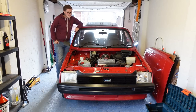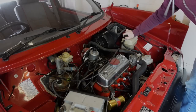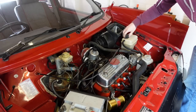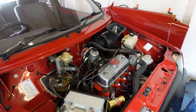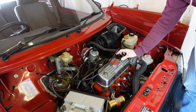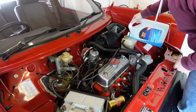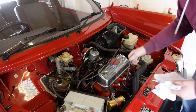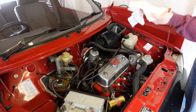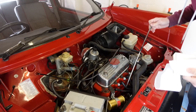With a few pumps of the clutch pedal any noises go away. She engages in each gear just fine and we've even got a working radiator fan. We'll have a final little top-up of coolant, a check of the oil, and I'll jack up the car to tighten the exhaust clamps — there's a leak at the bottom of the downpipe. But there's not much left to do now.